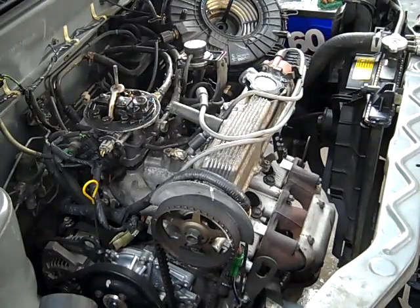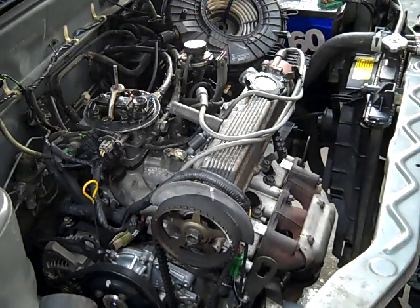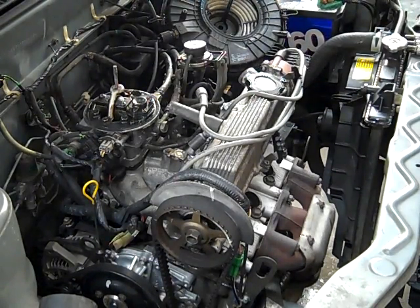And that is the reason that you don't do a compression check with the injector harness plugged in — that'll give you real numbers on your engine. A lot of you guys are doing compression checks and simply not getting the right numbers. Some of you are going through the motors and can't figure out why you can't get the compression to come up — really, you already had the compression before you redid the motor. We hope that helps. Remember: don't dump any oil in the cylinders ever to check it. When you check it, it's always dry, always with the injector unplugged. Thanks for checking out our website.